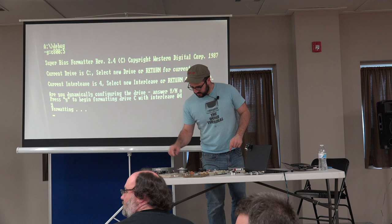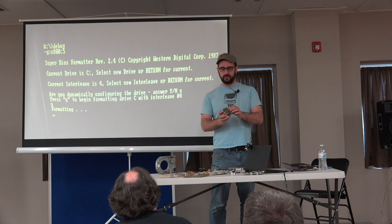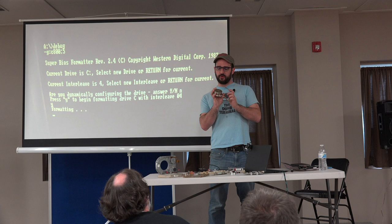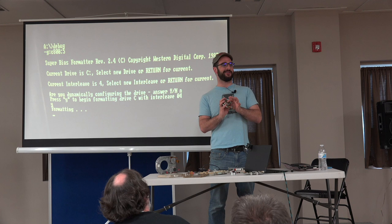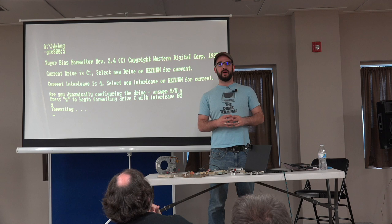On some of these, sometimes the button on there can be adjusted to make contact, or even backed off. The point was, there can be like a whining or a screaming noise. Spinning things make static electricity, so this little dimple on the bottom of the motor, when it's installed in the mechanism, has a little finger that reaches out and a little carbon pad that touches it, just barely touches it as a static ground, and can get worn down or a little wonky and make a lot of noise. And you can just shift it or bend it a little bit so it's touching on a new spot on the carbon, and I've read that it will quiet the drive sound. I've never had that work on any of my ST-506s, but...